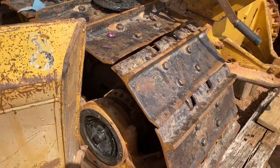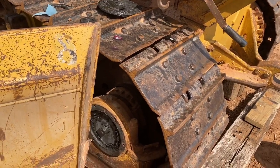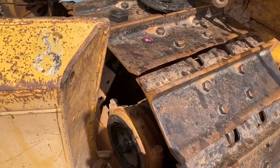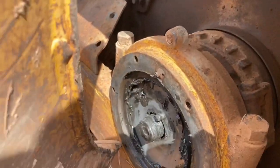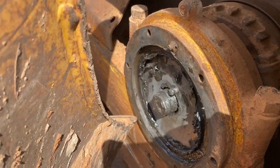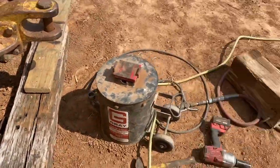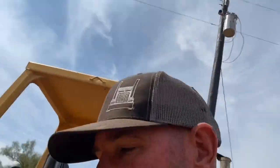But we're about 2 miles from this guy's barn. So my thinking is, get that nut on there as far as we can get it, spot weld it, and get the bolts back in the suspension deal. We got the broke ones out, and spot weld that nut back on there and get it up to the barn where it's a lot easier to work on.